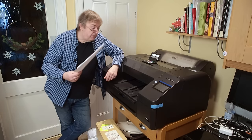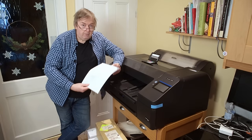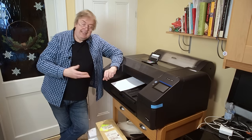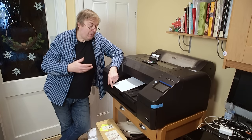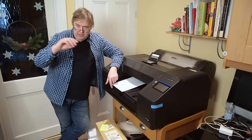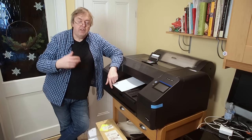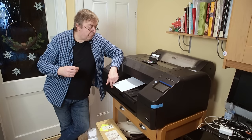So that's all I would do for this particular printer. Every week or two I would print a nozzle check just to keep it busy, because it's an expensive printer and you don't want it going wrong. It's a brand new model so we've got no experience of it. The likelihood of printers failing increases with the number of times and the amount of time you don't use them.